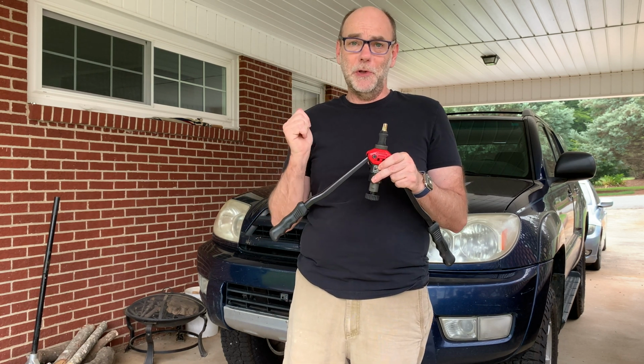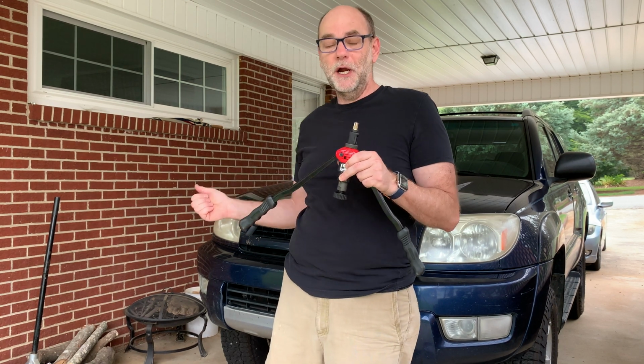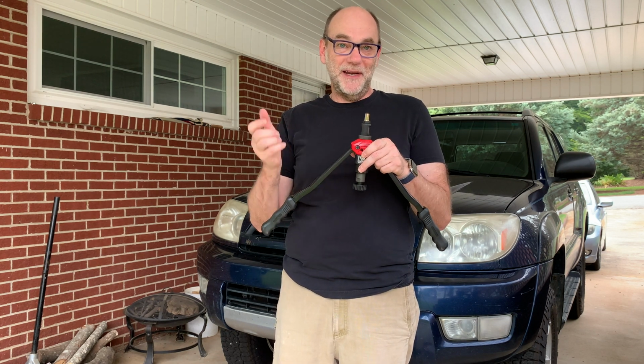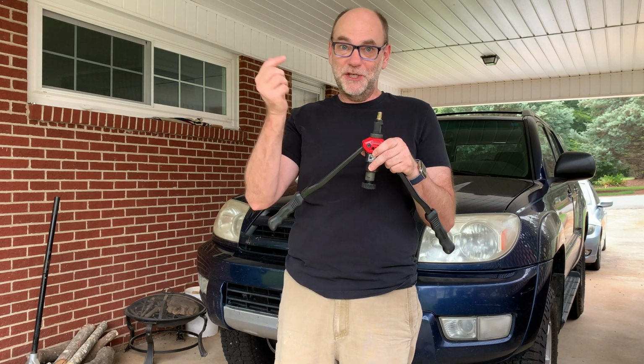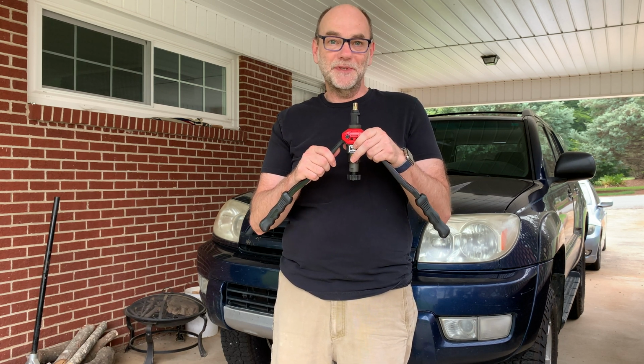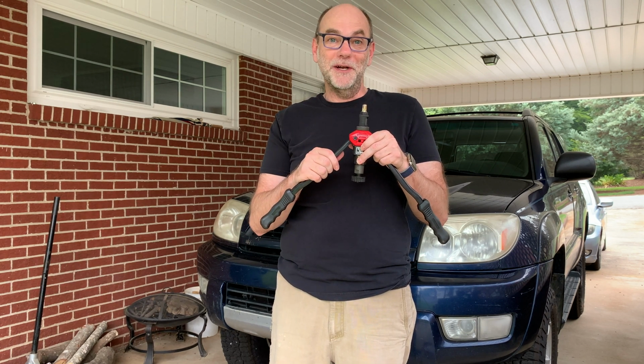Okay, it's actually another day, and what happened was it took so long for me to get the old bolt out of this mounting point over here. And if you were watching, you probably saw that I was making some rookie mistakes there and didn't drill a pilot hole first and then go up to my index size. So I finally did that and got the hole big enough, and then I had to chisel out the old barrel up in there that had the threads in it, and it was bigger. So I had to chisel all that out. That just took a long time. So I cut the camera off, and when I finally got done, the skies here opened up and just dumped rain on us. So I had to clean up and call it quits for the day.